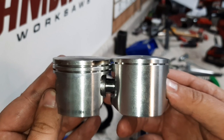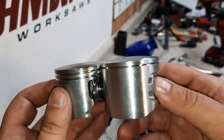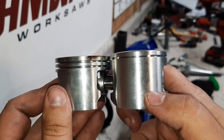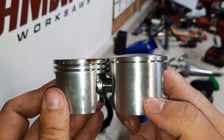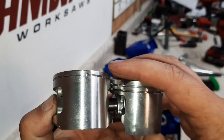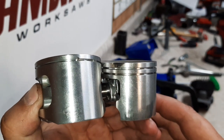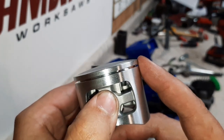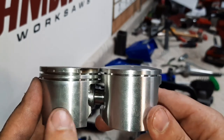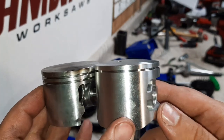I'm going to do a piston swap on this one. You can see the piston on the right is the one I'm swapping with — this is an echo piston. The exhaust skirt is about 200 thousandths wider, just shy of a quarter inch. It's only a little bit taller and it does have a little bit of dome. The intake skirts are about the same width, but the echo piston uses a single ring centered pin. So that will let me put finger ports in this. Normally people on the Stihls will flip the piston and leave the exhaust narrow to run fingers with the stock piston. I found this piston and I wanted to try it out.